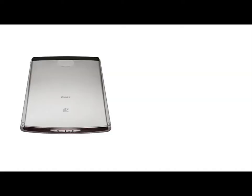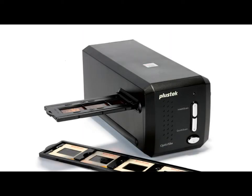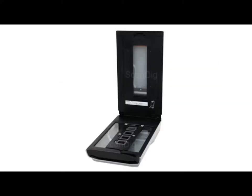The last route was to use a flatbed scanner to capture the film. In 2004 I purchased a Canon LIDE model with a transparency adapter. This worked well enough for 35mm film, but for movie film it was slow and scanned at 2400 DPI, giving me only about 500x400 pixels, which didn't justify the potential labor involved. There are dedicated film scanners, but they're usually for 35mm negatives and can't handle a continuous strip. But in 2018 flatbed scanners are a lot better. I needed one anyway for work, so I bought a CanoScan 9000F Mark II with a built-in transparency unit. I've always liked Canon, and this project hasn't changed my mind.